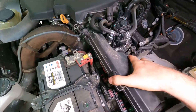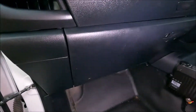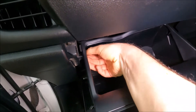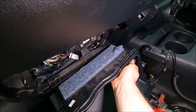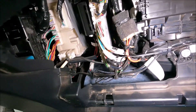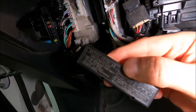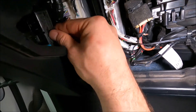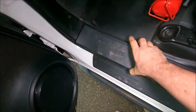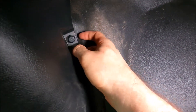Now we're going to go over to the passenger's side for the interior fuse boxes. We're going to take the glove box off by opening these two tabs here and taking them all the way out, which will allow you to take your glove box off. Then just inside on the left hand side you'll notice a cap — give that a tug and that will expose one of your small fuse boxes. It has your fuses noted on the outside of the cover. Always make sure you put that cover back on.